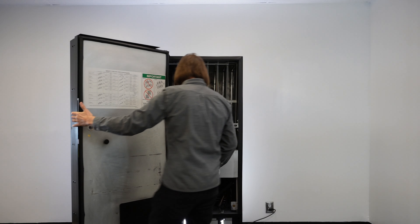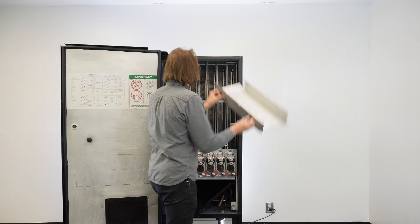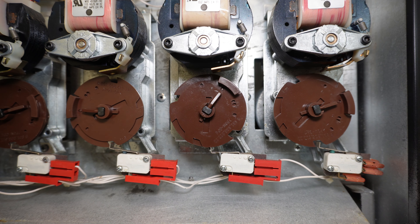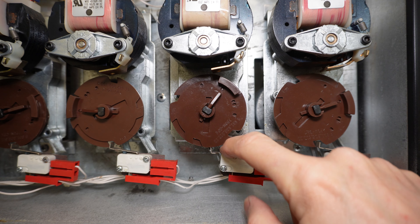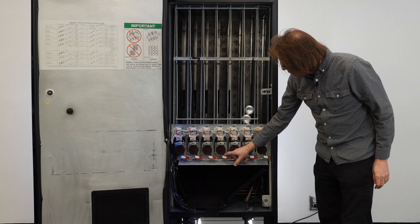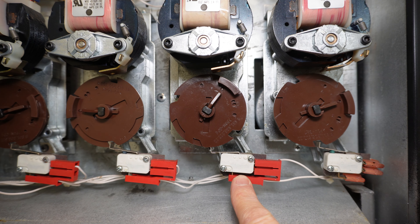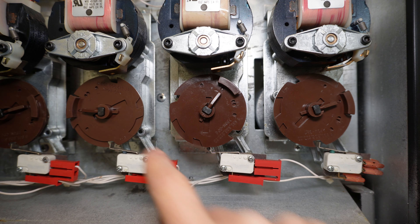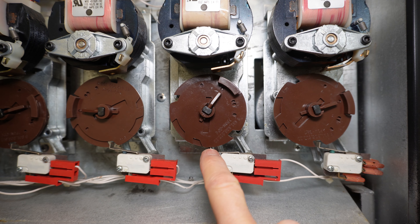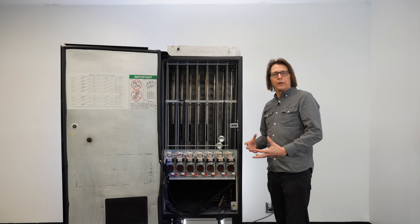Now if I open the door and remove the cover, we can take a closer look. The problem I've created is that I've stalled the motor so the home switch is not in a start notch. All these selections — three, four, five, six, and seven — have their home switches riding up against the timing cam in their home notch, so I can press down on them and they pull out of the notch. Number two I can't — this is already pressed down. So this motor is not back in its home position.